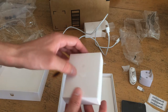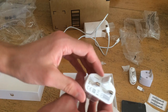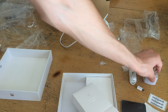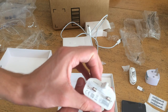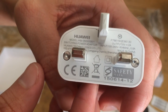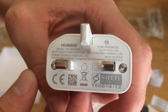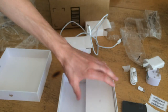This is probably the power adapter, the actual wall wart. And it looks like it's got a UK British-style plug attached to it — so that would be the reason for having the universal adapter. It's got a USB Type-A connector on this side. Let me zoom in on the specs. It looks like this is a 5V 2A charger. It does not appear to have 9V output, so this will not do the 9V fast charging over USB Type-C. However, it is still a 5V 2A charger, so that's always a good thing to have kicking around.